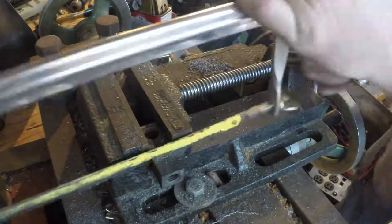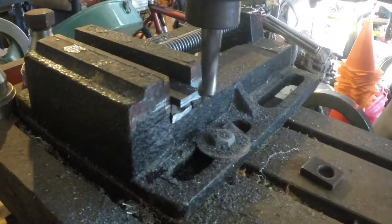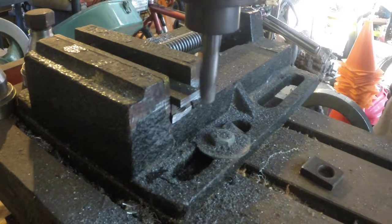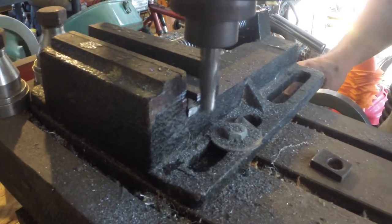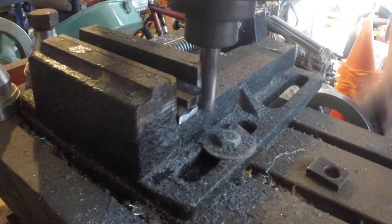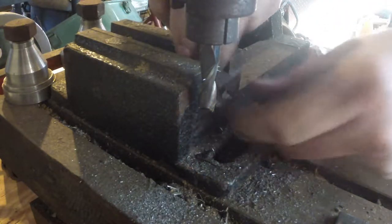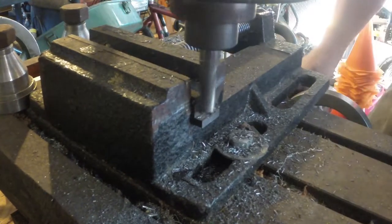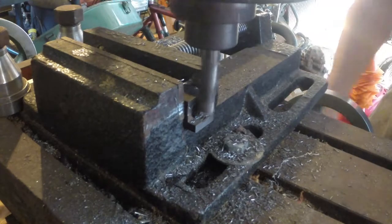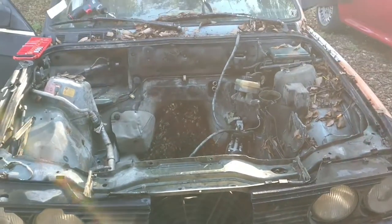This will let me maintain using the stock dirty brake booster. If I didn't, I'd have to do something like a Volkswagen Golf brake booster or a Renault Clio brake booster — I hear that works well, but good luck getting that in the United States, there are no Renaults here. There are about five brake boosters that work with it, but they require extensive modification, and I don't feel like doing that. So I'm going to relocate the stock booster.